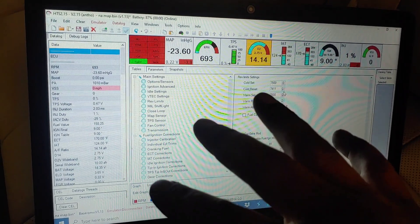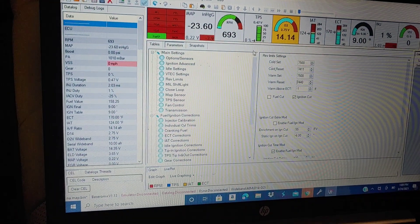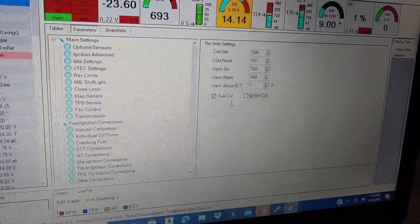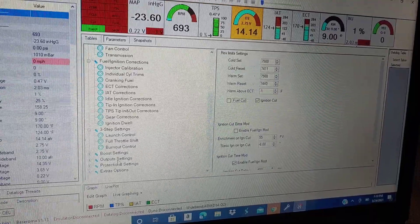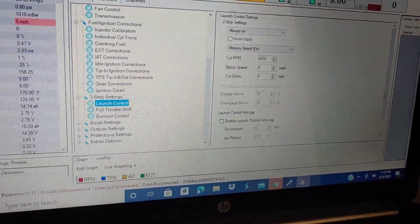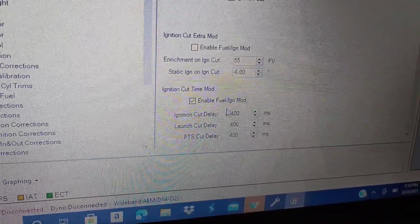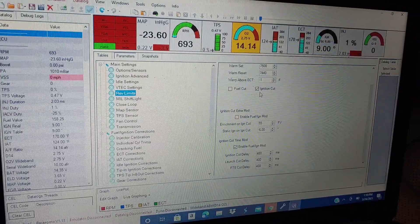Before I end this video, let me show you what I'm working with here — this is a software I use, it's called Honda Tuning Suite, or HTS for short, using version 2.15. So your rev limit settings are going to be right here under Parameters, Parameter tabs, Rev Limits — here to set the rev limit points. This is your fuel cut, ignition cut. The first way was fuel cut only, the second way was both, the final way was the third — ignition only. And then to play with the delay, you can go to Launch Control, under two-step settings. For the rev limit you adjust the delay in the rev limit tab — it's at the bottom, you gotta scroll down. Here's the ignition cut launch cut delay — you gotta enable fuel ignition mod, this is how you kind of fine tune the way it sounds. So these are my settings for my rev limit two-step — hope you like this video, later.